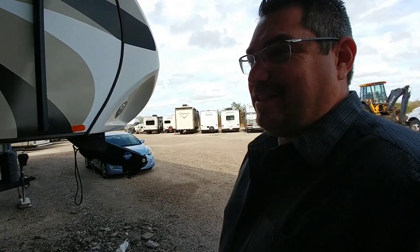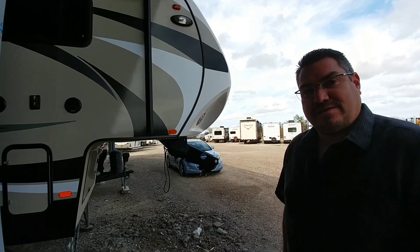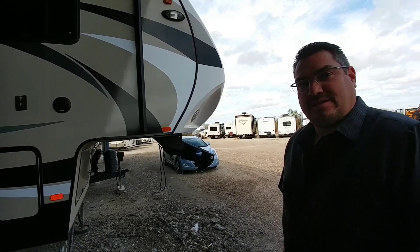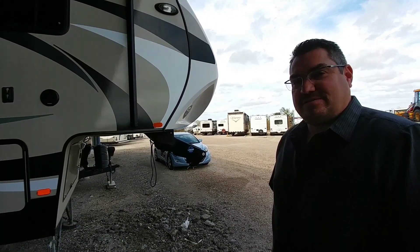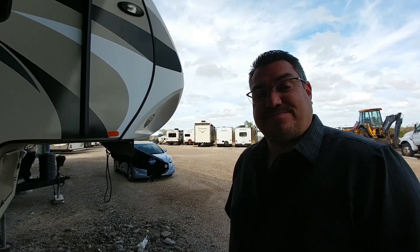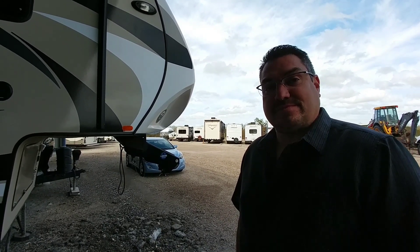That was one of the things I wanted to try before getting into a big trailer, and it towed really nice — much better than my small 23-foot travel trailer. And it handled the weight really well. That's the benefit of making sure your truck is spec'd out properly for your trailer. With 3,200 pounds worth of payload capacity, the pin weight is going to be roughly about 2,500 pounds, so you're going to have more than enough capacity to support the tongue weight plus anything you'll have in the back of your truck. It looked good and I thought the truck was going to be a little bit lower, but it actually just leveled out perfect.